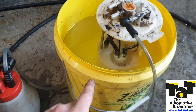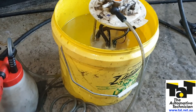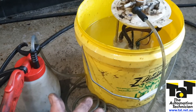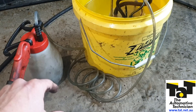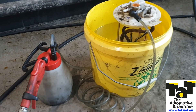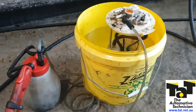So a quick little experiment. This is your fuel tank, this is your fuel pump fuel outlet coming from the fuel pump, and this is your fuel line and high-pressure pump with the trochoid pump in it - we're pretending. So while the car's running, it's able to suck quite easily through that fuel pump and it's enough to keep the car going. But once you stop, pull your fuel filter off, the system drains back, and you don't have your lift pump to bleed the thing - it doesn't go. We did try to suck up past the fuel filter, even right at the entry to the high-pressure fuel pump, but could not get it to go. You could try bulb-style pumps at that point, but really the customer needs a lift pump - getting it bled would be a disservice to them, because it's probably going to set some codes when they try to overtake a semi on the highway. Either way, you've got to tell them it needs a low-pressure pump inside the fuel tank.